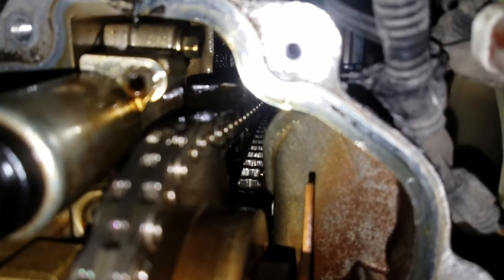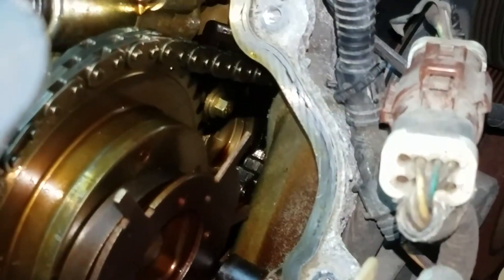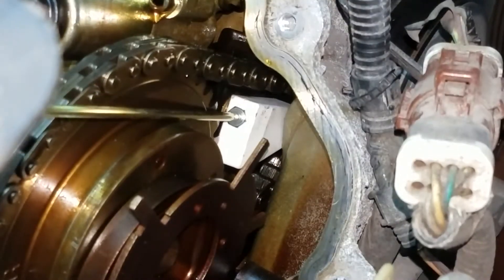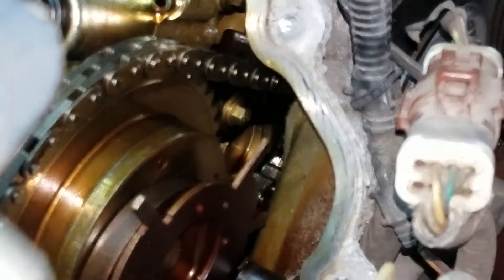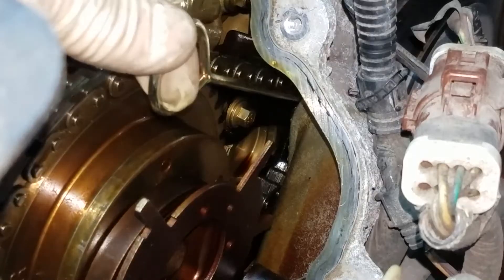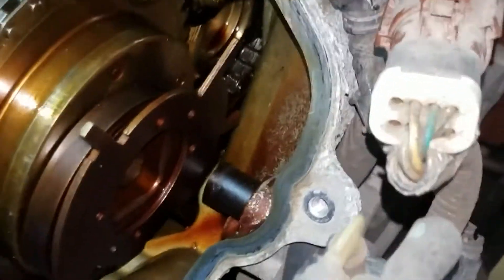The little wedge tool is actually going to stick right down in here between the two chains to hold the tensioners out. So we're going to go ahead and slide this sucker right down in here. Depending on which bank you're doing is going to depend on how this tool goes — we're doing the right bank. These come in two different styles: one with the steel rod like the one I have here, and some with just a steel cable. I prefer the one with the rod. We're going to take this sucker down in there and you're going to hear it actually kind of click in a few times. I got a click once, push a little higher and it'll click again. There it is — feels like it's in there pretty good, nice and snug.